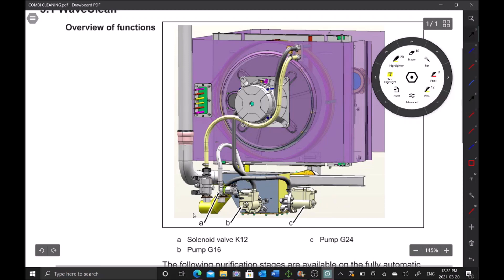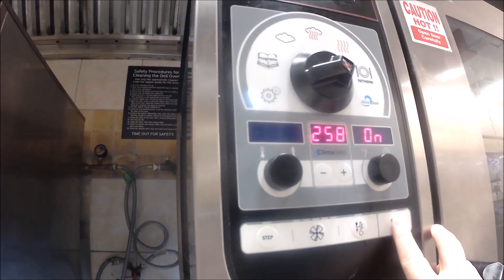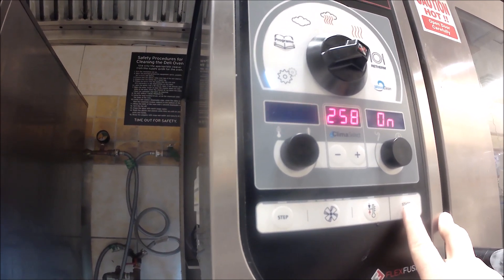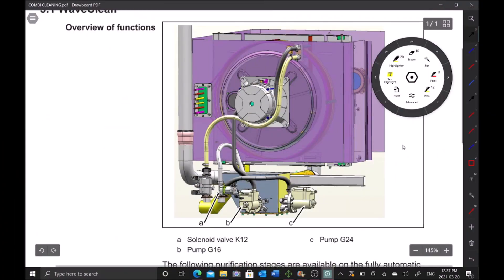The first thing we want to test is this solenoid. We're going to go into relay mode and run our K12 solenoid — relay number four, which is our quenching solenoid — and start filling up the box. You can see we have power. There's our K12 quenching solenoid and you should hear water pouring out of the drain. In our case the water is flowing but filling very slowly. It should have been dumping down that drain. We have an issue already.